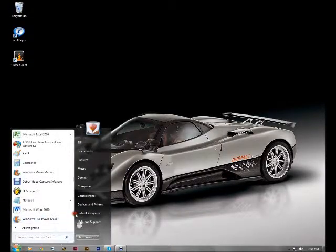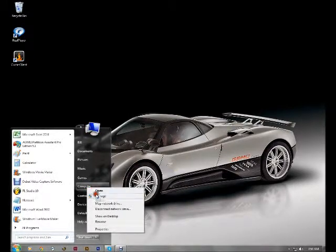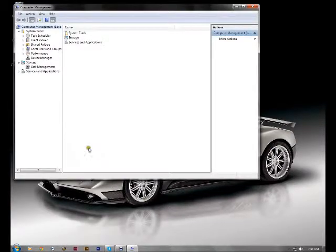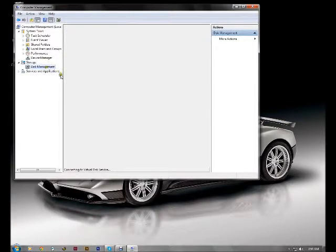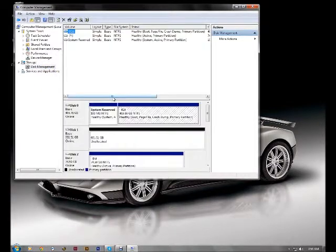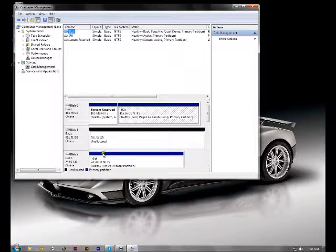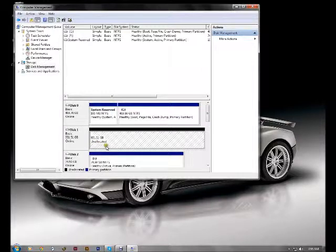So let's go into Computer, right click, Manage, let's see what we have. Go to Disk Management, and we have both of our drives. This is the internal drive of this computer. This is the 80GB drive with Windows 7 on it from the other Dell computer. This is the unallocated 1TB. So we can see both of the disks. I'm going to close that.